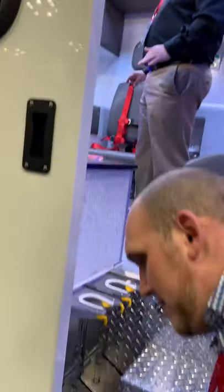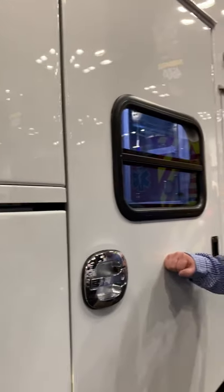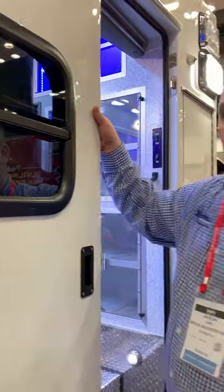The sliding door works on a roller system — there's a roller here, a roller up top, and a roller down below. The rollers are easy to replace; about every five years they may wear, and you just pop the pin out and replace it — very easy. There's a track inside including a white track that curves at the end. You can open the door as hard as you want, even on a hill, and it catches on a ball-and-socket system — a larger ball and two smaller ones to stop it. You can then come over and slam it shut. It also automatically triggers your scene lights.